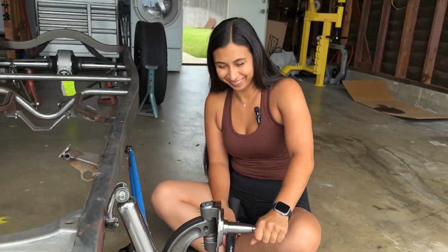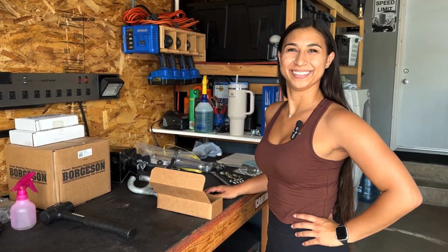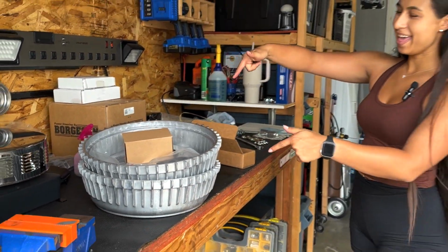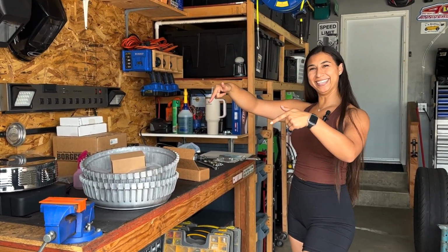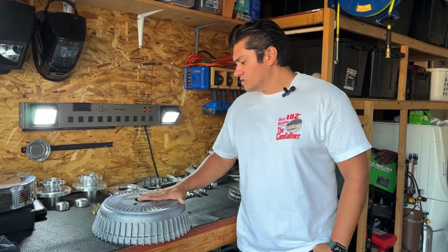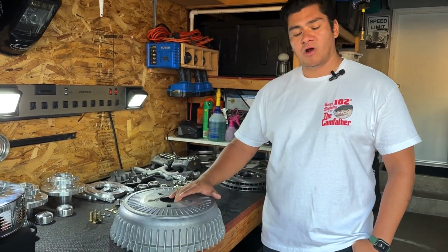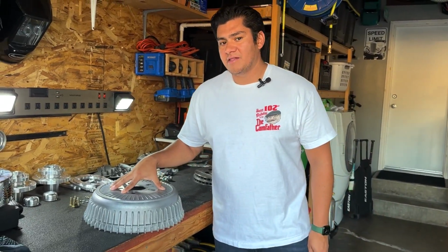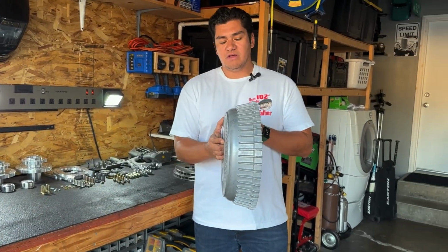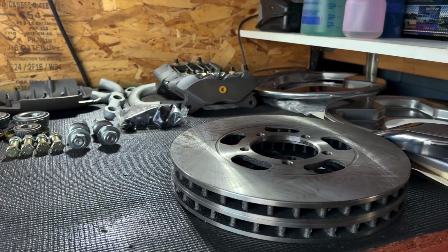All right, so now you ready to show the people the kind of brakes you got? All right, so Celyna got herself some of the best brakes in the market. These brakes were originally offered by SoCal. Now you can buy them from Roadster Supply, Vintage Parts Arizona, and hopefully very soon from CaliRod.com. In short, what's great about this brake is that it's covered by an old style Buick finned drum, but all that's doing is covering a more modern disc brake system.